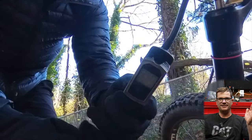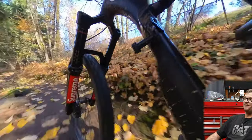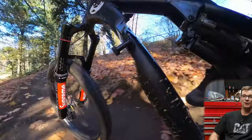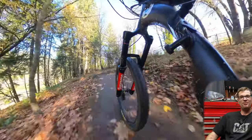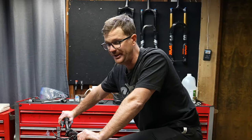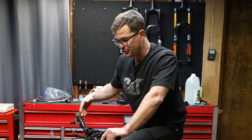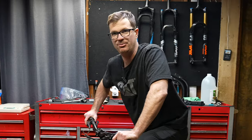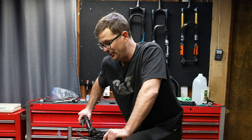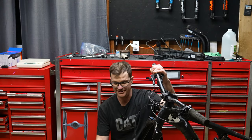There are kind of big gaps between the clicks. Once I got the air pressure dialed it was feeling amazing, and one click faster on the rebound felt even more amazing. This slightly modified air spring adds just a little bit of extra small-bump compliance the fork did not have. Now I discovered something super important on that ride: you need to disregard the sag indicators. This fork is best tuned from feel on the trail. That larger negative air chamber does have better breakaway pressure and it does feel smooth, but it is a little bit choppy — so ride it on a big compression and lower or increase the air pressure 5 PSI at a time. Be real careful with the rebound because one click is a lot of adjustment.